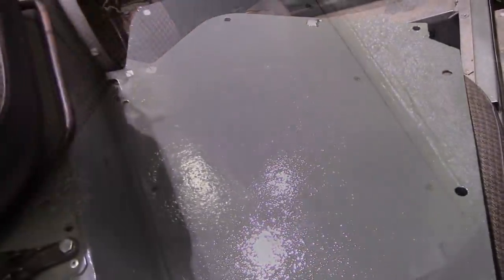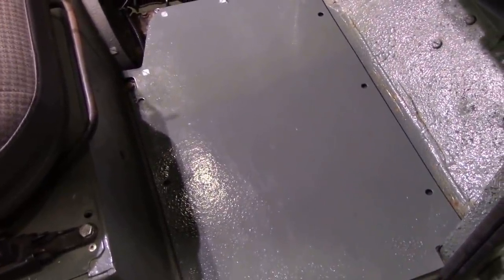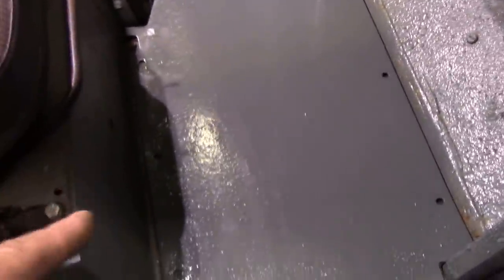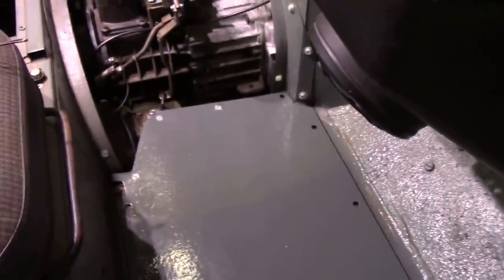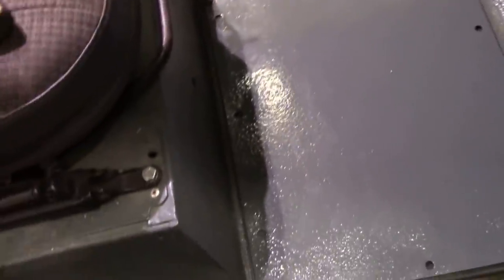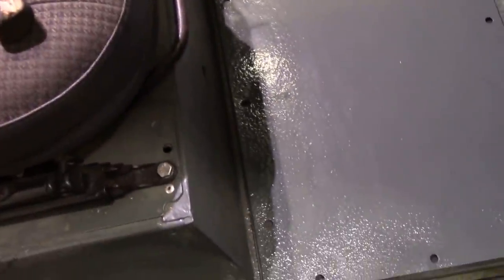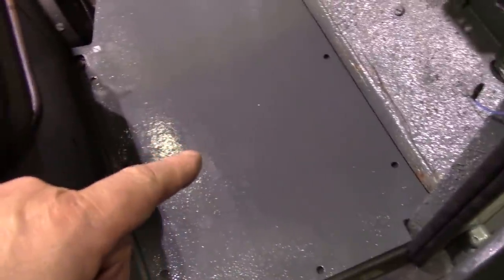With the floor in place, this is one of the biggest problems a lot of Land Rover builders building from scratch have. The reason is you don't know the distance between the seat base and the bulkhead until you put the floor in. I've seen people with the holes in the floor way out because they haven't shimmed the bulkhead properly backwards and forwards. A lot of people make the mistake of going like a bull in a china shop and putting the self-tapping screws in, tearing the seal.